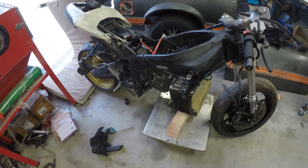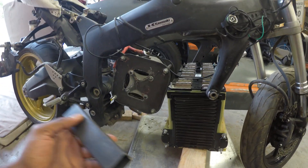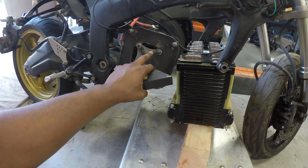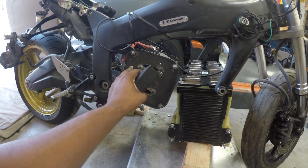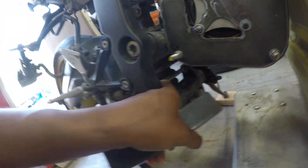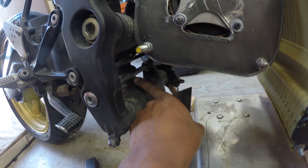Now that you've seen the battery mounting in the frame, I'm actually going to mount it a little bit lower than I originally showed you — I want to keep the center of gravity as low as possible on the bike. Here's my simple motor mounting solution: just a piece of square stock mild steel. As you saw in the previous clip, I made this entire motor assembly where the motor serves as a structural member of the frame. It bolts to the existing mounts where the original motor mounted, using that little round tubing I made. All I'm going to do is weld this square stock to that metal bracket.